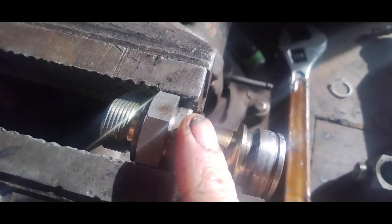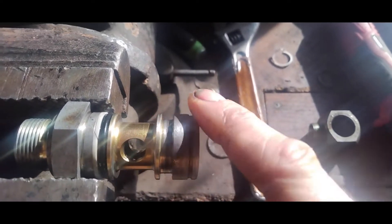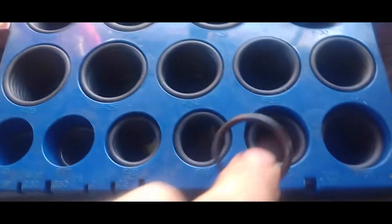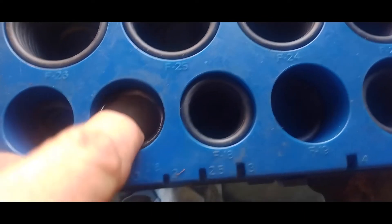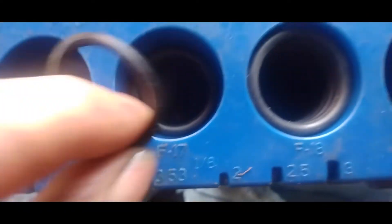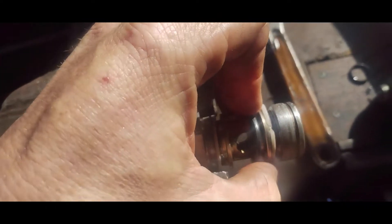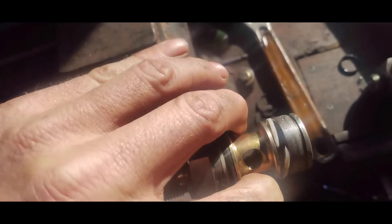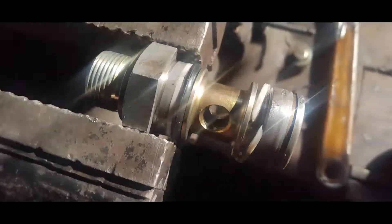You won't be able to pull it off over this side without tearing it, but if you're replacing it anyway it doesn't matter — you could pull it off this side and fish it out. If you have an o-ring kit, pick these up from NAPA. Size up your o-ring — this one looks like an F-17. Work it around; I'll go to the far side first. Alright, I got the first o-ring on.